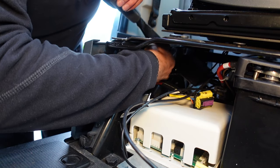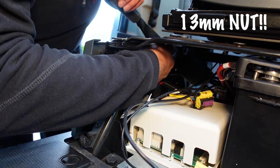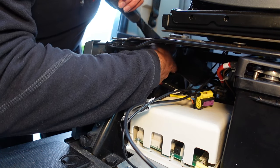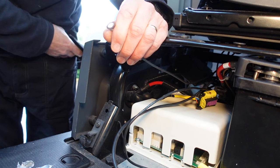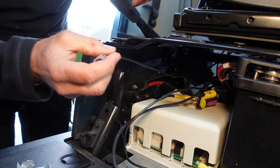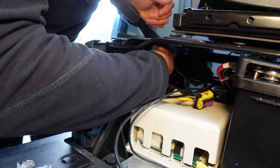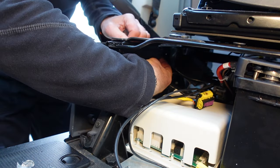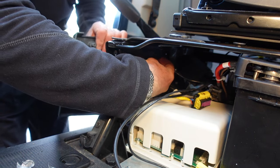What we didn't do is on this bolt under here — this 13mm — which Slow forgot, is the earth lead for your seatbelt tensioner which I taped up so it didn't catch anything. This earthing strap goes on this bolt under here where the 13mm is going to go — put that up first and then nut it. A bit awkward. It can help if you pull the seat apart there. Don't forget you've got your battery isolator on there.